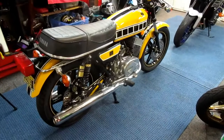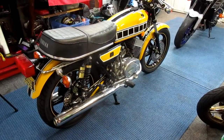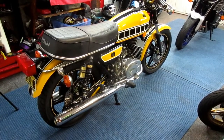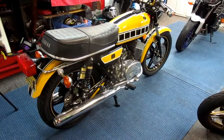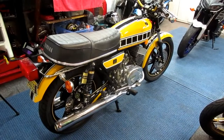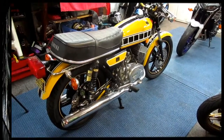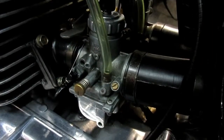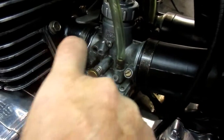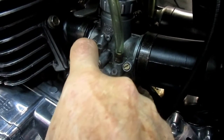Now, just to be honest, I checked around a lot of sources of places that sell parts for these bikes. Nobody had a direct, brand new set of carburetors. That was in the unobtainium. So that would have been my first choice, brand new in the box from Yamaha. Not available. Sudco is certainly a good second choice. So first step on this, pretty straightforward. Phillips screwdriver, loosen the clamps front and back. I have to take my safety wire off, which is not stock.